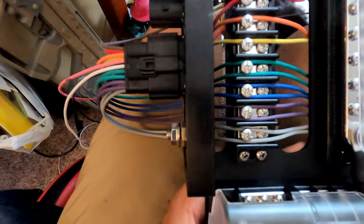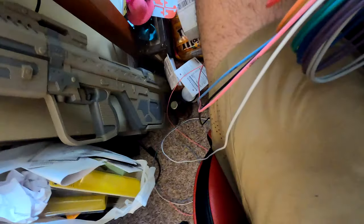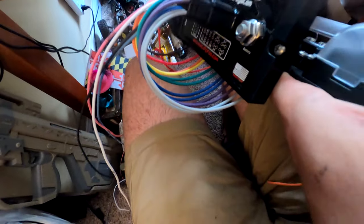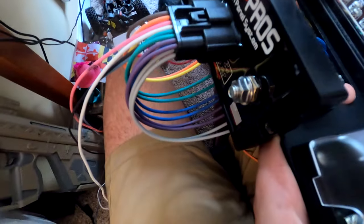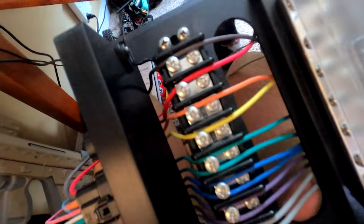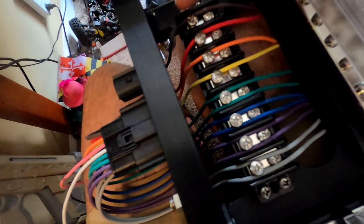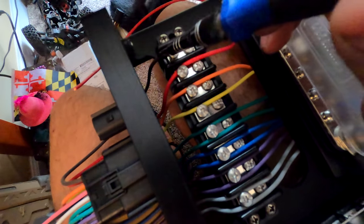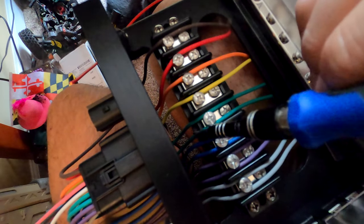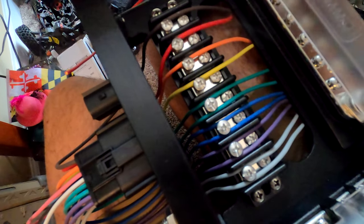Here's how I have it set up: it's plugged in with all the cables coming out, the trigger wires and ground dangling to the side. I ran them up underneath the Switch Pros, keeping them at relatively even length, then tapped each into their slots in the terminal board with switch number one on the far left. Next I'm going to go along and snip each of these wires to the same length - I'll run a sharpie down here, pull them off, and cut and strip from there.